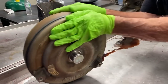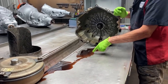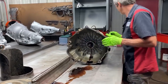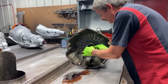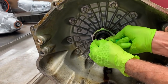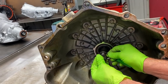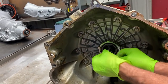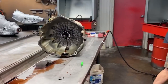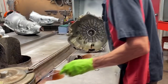Now this is just a factory torque converter. You can see here what the fluid looks like — it's just really dark. We can get our lock-up O-ring off here. That's hard as a rock — that's a big problem right there, right off the bat. Just having hard seals on these trannies and stuff like that.